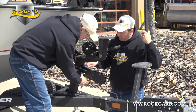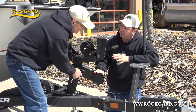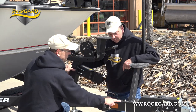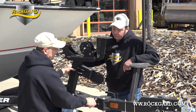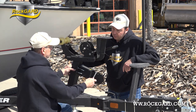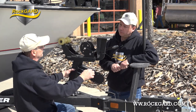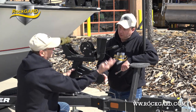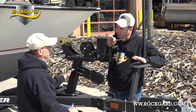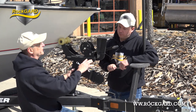This is an alternate center post system. Normally, a center post would get mounted onto your tongue with a much simpler bracket. But because we have a swing tongue, and it's very short after the swing tongue, we use this bracket to mount onto the crank mast instead. That gives us a lot more flexibility for where we can mount the post itself. We have a big bolt pattern here, and that also allows it to not interfere with any steps on your boat — you can dictate where the center post could be.